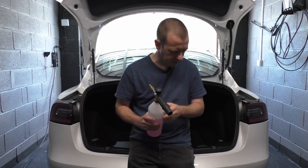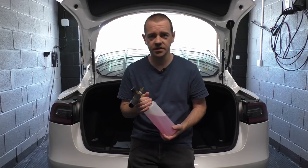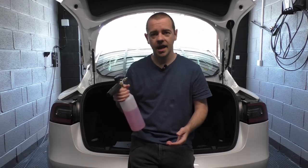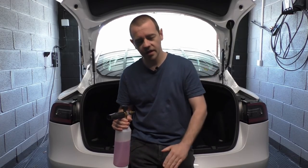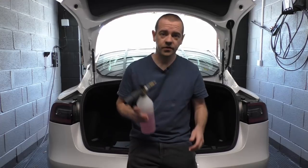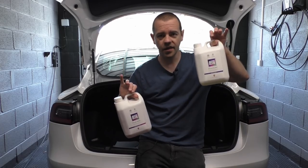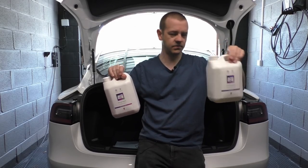The pre-rinse is literally optional, just as it sounds. Think of it like pre-rinsing your dishes before putting them in a dishwasher — you're covering the car in a shampoo-like formula that eats away grime, dirt and grease, so when you give it the first jet wash most of that stuff is already gone. If you are using a snow foam lance, I'd recommend Autoglym Polar Blast as your pre-rinse and Autoglym Polar Wash as your shampoo — it's diluted roughly one-in-five so it lasts ages.